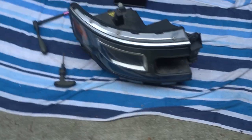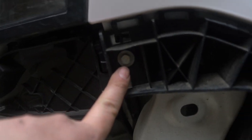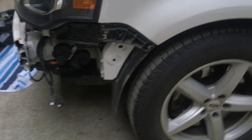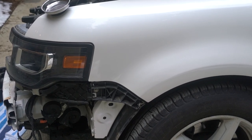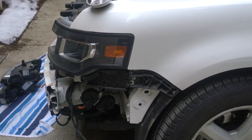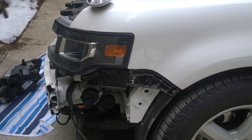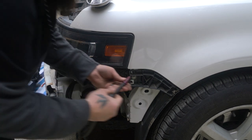I was actually poking around the headlight right after I signed off, and the other headlight came right out. So, I'm gonna go ahead and show you guys now. Boom, this thing looks straight there. Literally all it was was this guy. One more 10, and she came right out, unplugged it. But it's definitely the bumper that was keeping us from being able to get it out, because basically all this sits behind the bumper.